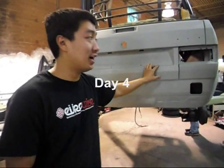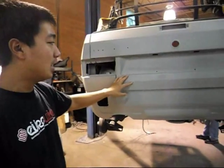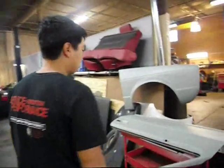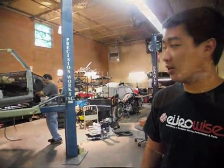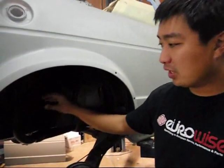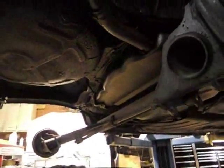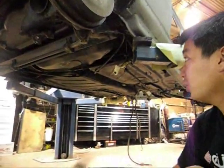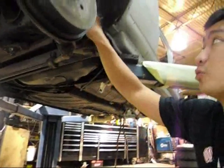It's Day 4, Monday. Over the weekend we got a lot of body work done. Sanded all the panels the best we could and primed the whole car — the doors, the fenders. We're about to get everything ready for paint. Tonight we'll hopefully paint the engine bay in our paint booth, and we'll paint the rest of the body once we get the engine in. We also got a lot of the undercoating done. We lifted it up outside on our scissor lift and sprayed undercoating underneath the car — the gas tank and pretty much all the floors. That protects everything from the weather, keeps it from chipping and rust. We pretty much coated the entire bottom of the car with this really sharp undercoating.